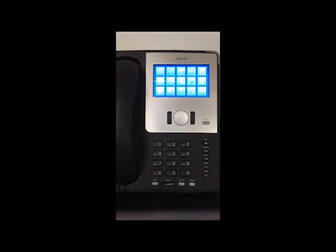Here you can see that it was assigned the IP 192.168.0.33, meaning that the phone is connecting to the wireless local area network. The phone application is now starting, and it indicates firmware version 8.4.35, which is the recommended one by SNOM. And that's it for the tutorial for connecting the SNOM 870 to the wireless local area network.